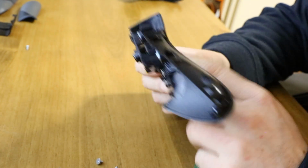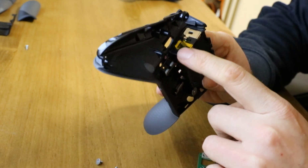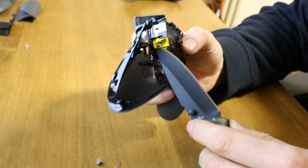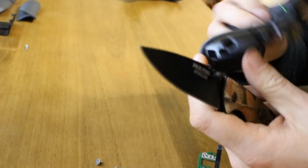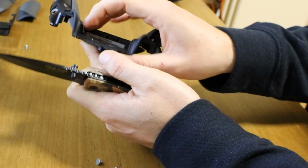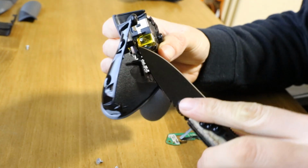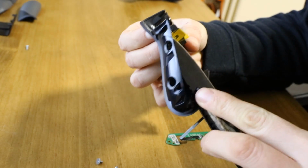And then the other thing really left on this back panel, short of just removing the magnets, is this battery clip. So you can remove the battery clip by there's 2 little tabs here, black tabs. So again, if you get something like a knife or anything to pry underneath, and from the other side you're pushing down on these. So if I get my fingers over, so we can get the camera to see, sort of over them, to be pushing downwards, and then I get under these tabs and simply lift them up.